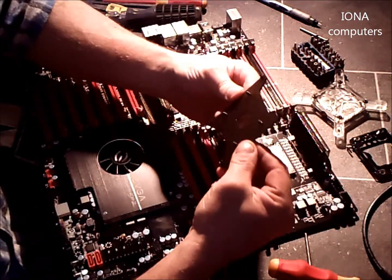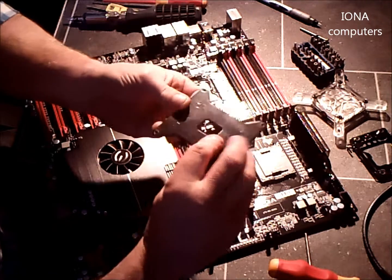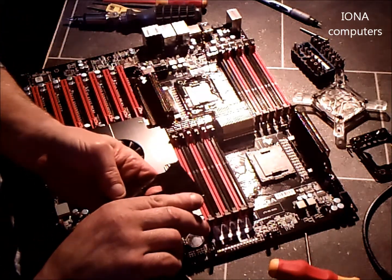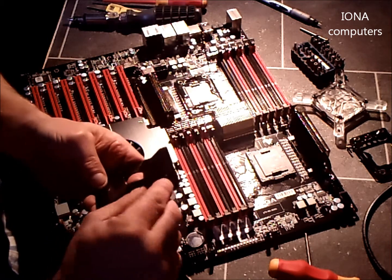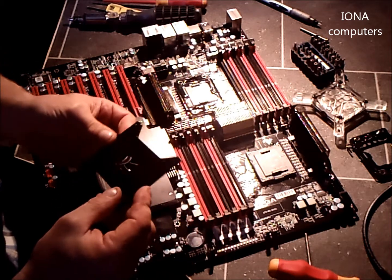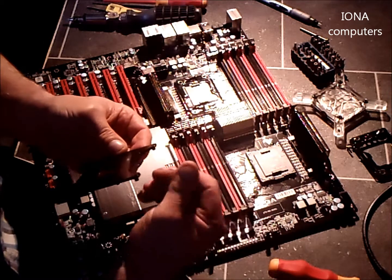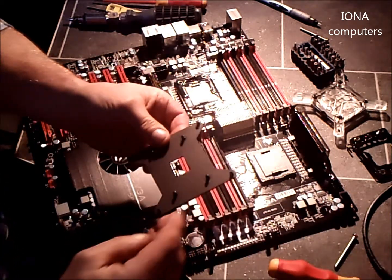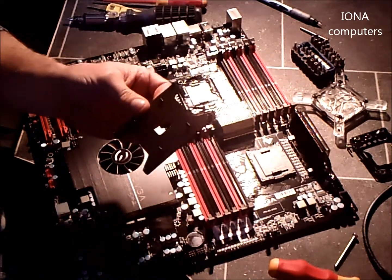Take your plate, check it, make sure that it's a universal size. What you've got to do then is drive these out. You'll see that this can be pressed out — it's a separate fitting. So I'm going to do that now and show you what happens. Once you've pressed them out, you're going to be able to install the heavier duty fittings into the back plate, and then put the back plate back on again.